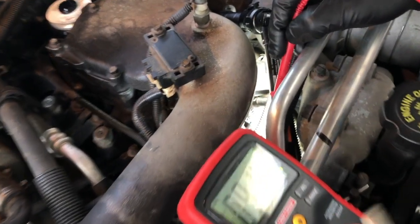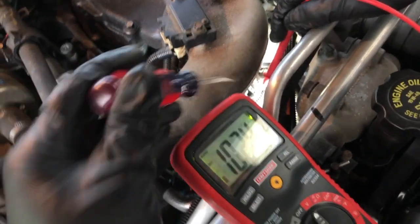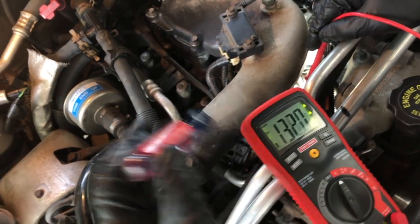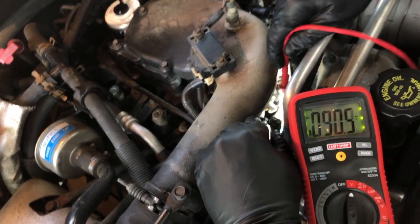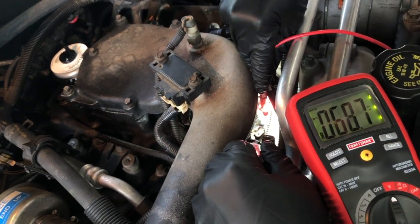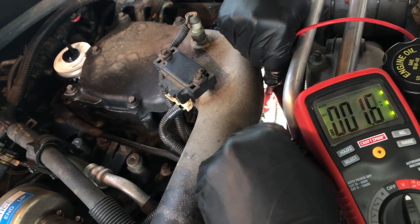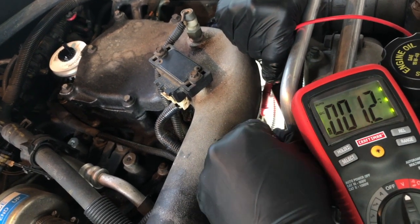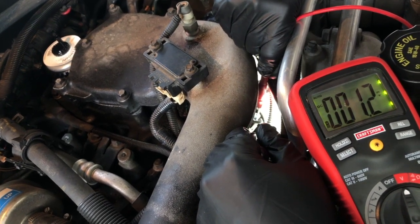But the first thing I'm going to do is run this voltmeter test to the reference ground. What we're interested in watching is what voltage we get read off of the meter here. So I'm just using this screwdriver to give me something to have some leverage on so I can push against this connector to get good contact on that end pin, that reference voltage pin. All right, so we're getting, if I could just get a better push on it. Just doesn't want to stay put. All right, so we're getting nothing right now except 1.2 millivolts.